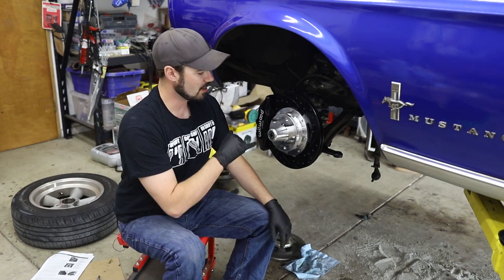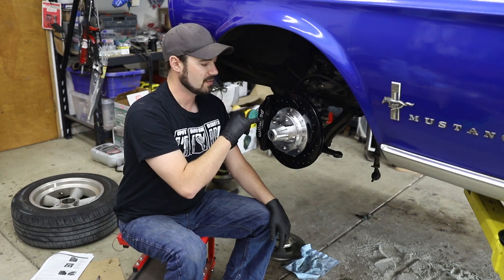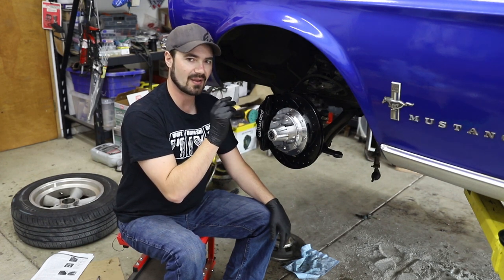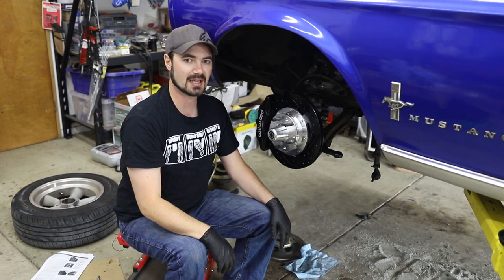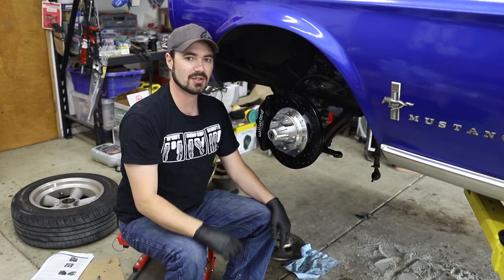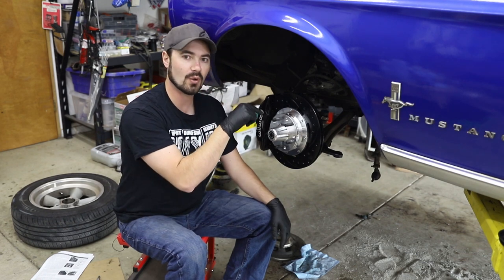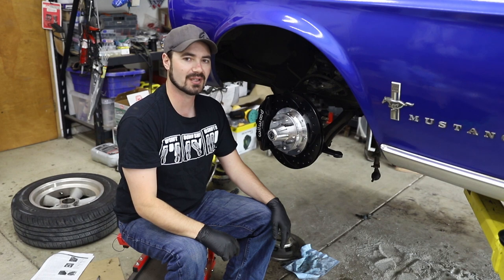So first of all, when I put this hub assembly onto the spindle, Maier Racing warns you that you may not be able to get the castle nut on there without having a thinner castle nut because there's not enough threads before the unit is compressed into place. I have the opposite problem. If I run that castle nut all the way down the spindle, I can't even engage it to the cotter pin. There was enough room that I could put a whole other nut below it and then put the castle nut on, and it fit perfectly.